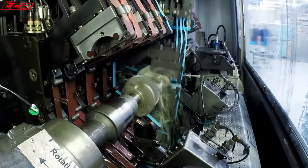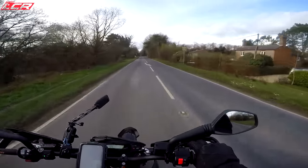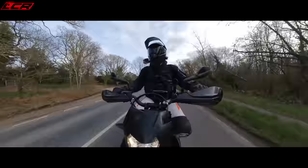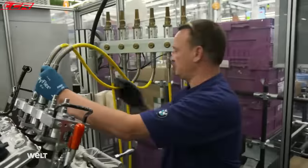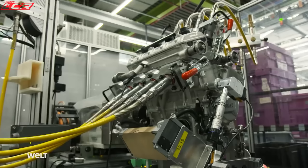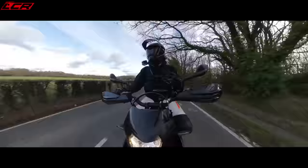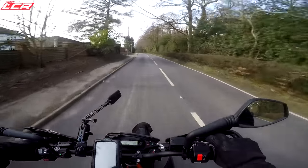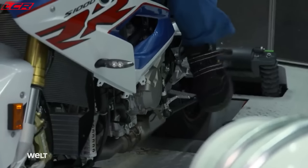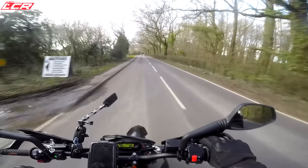What I really wanted to highlight: a lot of people will tell you the engines are bench-run when you buy the bike, so they're basically run in already. That isn't true. Watching that video, the engines are run up on a motor — they connect air connectors to the barrels and just measure the volumes of air going through. So they're not actually run; it's called dry running. They've just been spun up by a motor long enough to confirm there are no air leaks. The only time they're run up is at the end when the whole bike is assembled — they start it, put it on the dyno, and run it through the gears. And they're not particularly gentle. But that's it — the bikes are un-run-in.